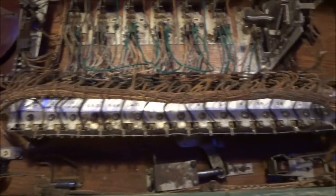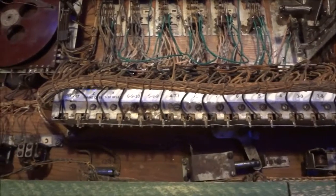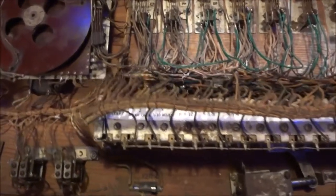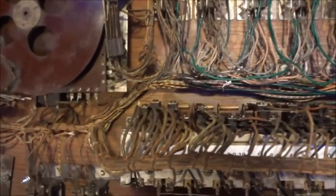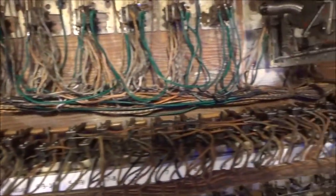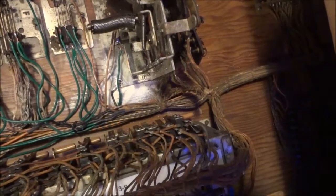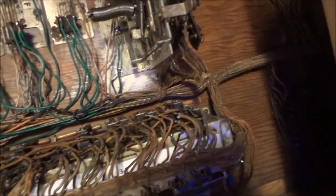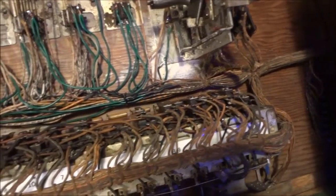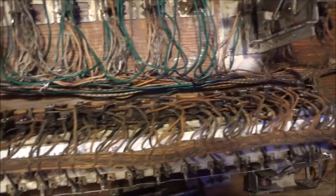And this is quite a formidable early setup bank that they have here. So, as usual, if you have any kind of problems, the first place you look is the setup bank. There's a whole lot of soldering going on in these tabs, and they can be problematic sometimes. With old games, the solder tabs just fall off, and in this mass of solder joints, you've got to find the one that fell off and then try to figure out how to get a soldering iron in there to fix it.